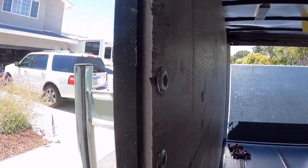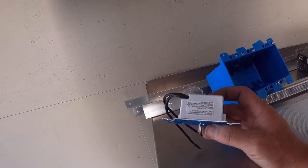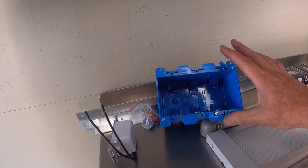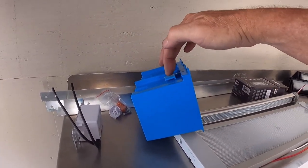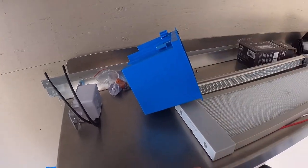This is all thin wall - it's only one-inch tubing so there's not a lot of depth in this wall. I can cut a pocket in the plywood and feed wires up to the top - that's not a problem. But the timers are a little bit thicker so I've got to play with the depth. What I like to do is use a standard electrical box to lay it out instead of just putting them into the ply. It's 12 volts so it's not really a voltage issue. I'm going to cut the box at depth with a saw and hopefully get it to fit inside that plywood, basically just using the trim ring and a standard outlet cover. I may need to bump it out with an extension a little bit - we'll get to that as I figure it out.